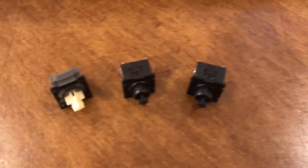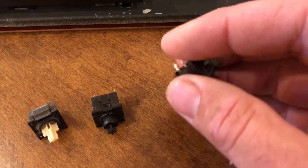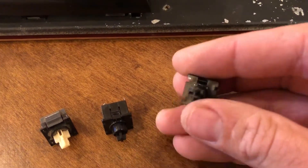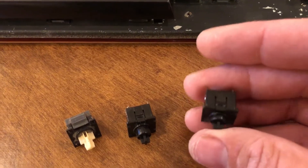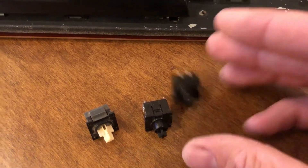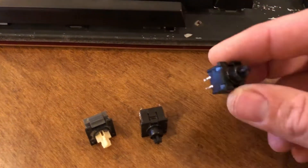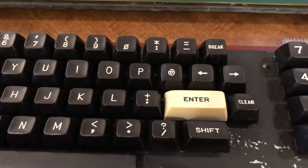The best part about this keyboard is right here. These are the key switches on the regular factory keyboard — they're unobtainable and known to just go out. The conductive material inside on the rubber dome just wears out. If you want to fix it, you could pull them apart and paint conductive material on the domes.